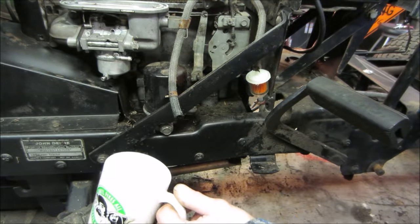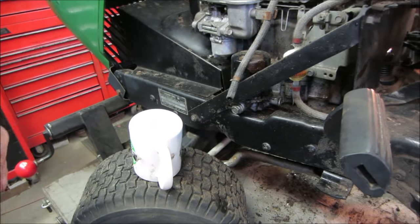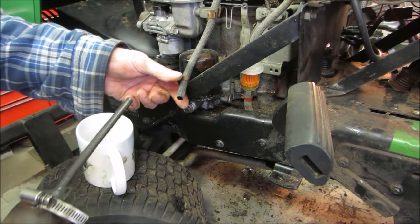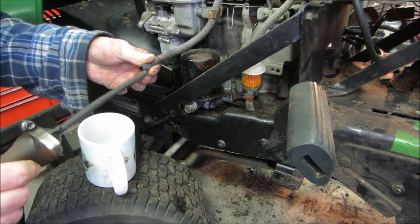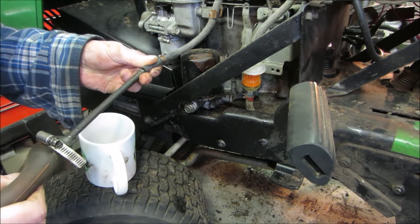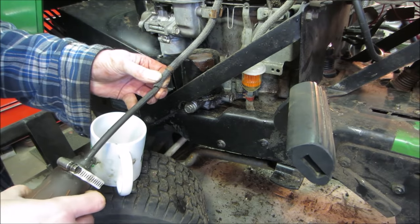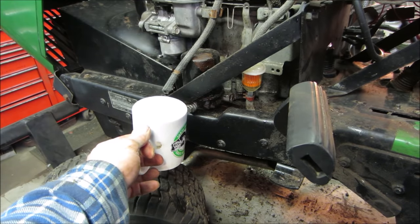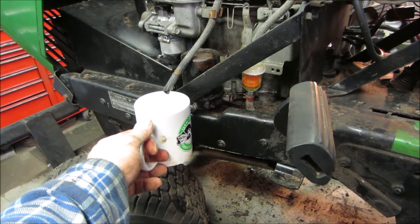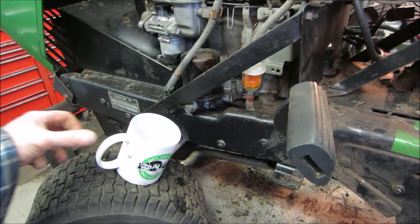Do you hate when that happens? All right. I'm going to try shooting air from the other side, try to get the diaphragms to seat, and I'll bring you back when I get it squared away. Try to draw through with the turkey baster. See if you can see the fuel filter. See if that seated it. Might have. I'm gonna put a little bit of fuel in it, get some RPMs going, see if that'll do it for us.